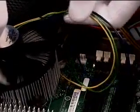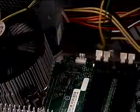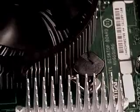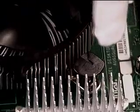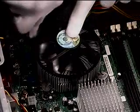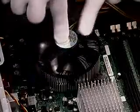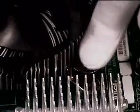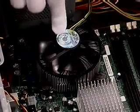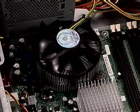Before actuating the fastener caps, ensure that the power cables are not trapped or otherwise infringing on fastener operation. Also make sure that the fastener slots are pointing straight out from the heatsink. To activate the 4 caps, press down on them with your fingertip while applying downward pressure on the heatsink to prevent it from tilting. You do not need to rotate the fasteners during installation. Check that both the fastener caps and the base are flush with the motherboard.